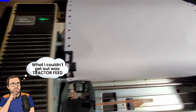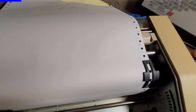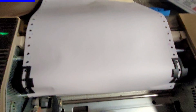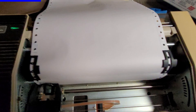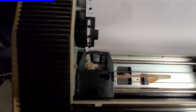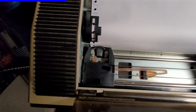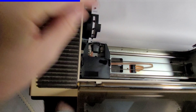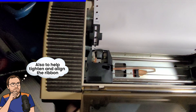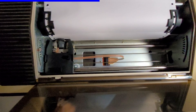This is a pretty simple device. We have these pin-head type feeders - you can literally move the paper forward fine, but going backwards it starts to roll up and you have to reach back and pull the paper out, which is one reason people didn't like these printers. Down here we have a cable running to the print heads, which push against the ribbon to transfer ink to paper. There's a little feed adjustment so you can advance the ribbon to a part that still has more ink.